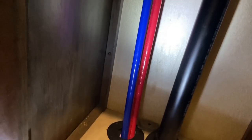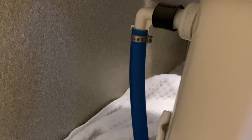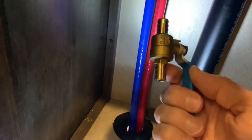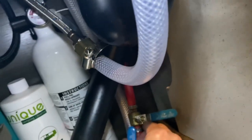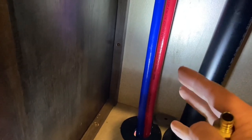I'll start off in here — this is the plumbing underneath my sink in my bathroom. You can see we have the hot water line and a cold water line, and you're going to want to install a shutoff on both of those. Now I have two kinds of PEX in my camper. This is the soft PEX hosing, which isn't used in too many places. In other places like underneath my kitchen sink and behind the toilet, we have the hard half inch PEX. It doesn't matter if it's soft or hard — you can use this on any of it. You can also use this on the reinforced vinyl PVC piping that you may see, which is clear and a little bit thicker and harder on the outside.